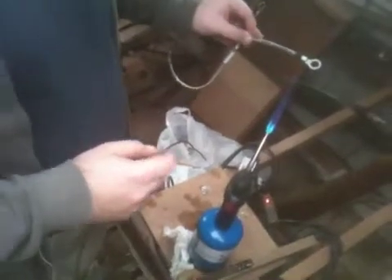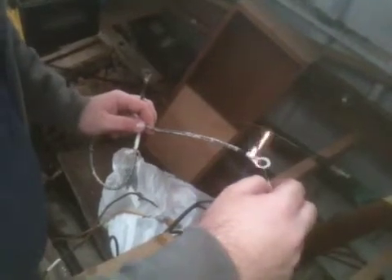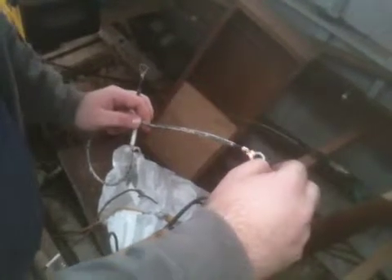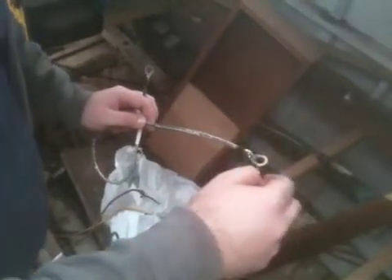What we do here is we just heat it up, and again just wait until you're seeing the metal is shiny. Hold the wire back a bit because it is going to get hot on you. Just sort of touch it, wait until it melts properly. And there we go — then it'll just start flowing. Tip it back a bit so that your solder's running towards the wire. If you get a big bulge of solder underneath, it's going to get in the way of your bolt and you can't get a proper seal. Just blow on it a bit and hold it until it solidifies.